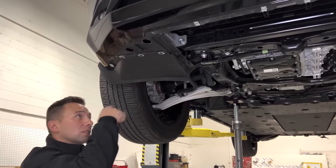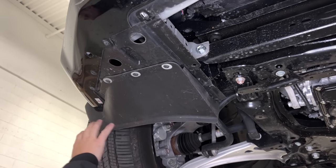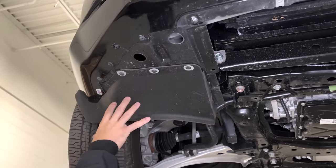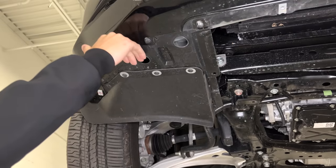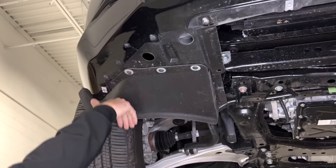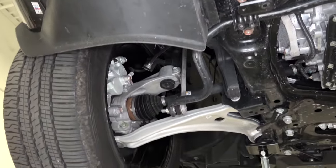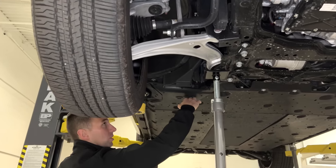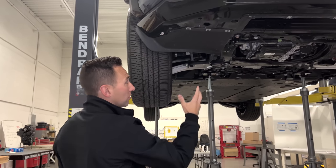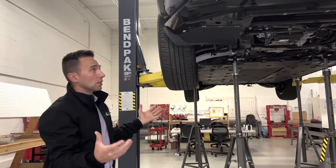Now, moving back, some of the first things that caught our eyes when looking underneath this, some of the aero shields, is these guys right here. These are often referred to as spats, or these wheel envelope guides or deflectors. What these are here for is, as the slipstream comes to the vehicle, this lip and this ramp on this feature help shoot that air around the wheel envelope, such that the air can go underbody, and as that air stream comes back up, it'll hit the aero shields back here. Really what you're trying to avoid is air getting into this wheel envelope, because that has a suction or a vortex effect, which is ultimately going to increase drag.